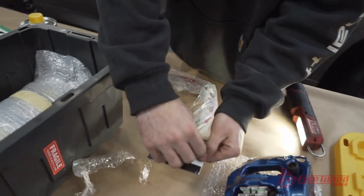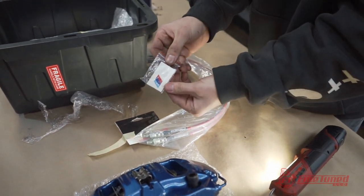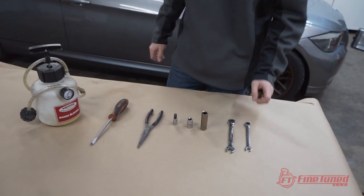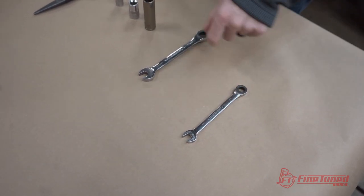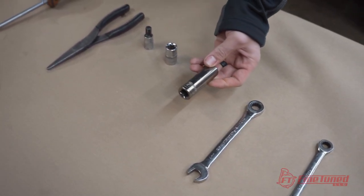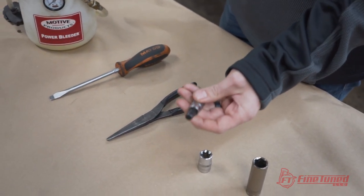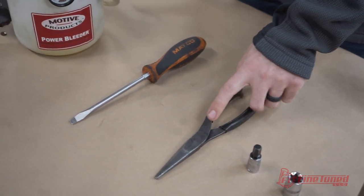Included here, he actually put some nice decals on with the package. So what happens with these is the front caliper gets worn out, so I'll go ahead and replace that with a nice new caliper. Tools needed for this job: we have an 11 millimeter wrench for the hard brake line to the flexible brake line, a 14 millimeter wrench for the flexible brake line to the brake caliper, 17 millimeter for the lug nuts, an E18 socket for the brake caliper bolts, and a 10 millimeter Allen key for the brake caliper to the new brake bracket.